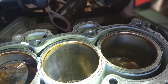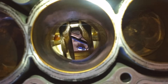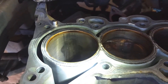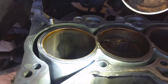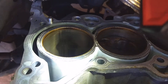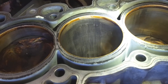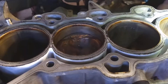You can definitely feel it with your finger, and usually it will be more on one side than the other — on this side it's good, on this side it's not. Now, you can see cylinder number one started developing a slap, but it wasn't too much play to cause the knock, so we were not going to be able to hear number one. But number three is the one that was knocking really, really bad. Number four looks fine, number two looks okay as well.